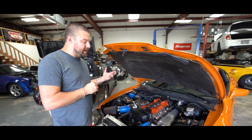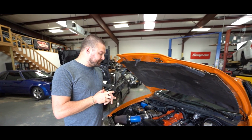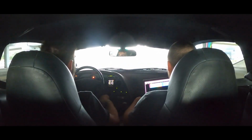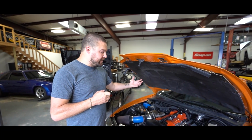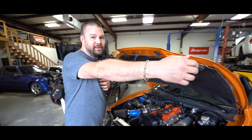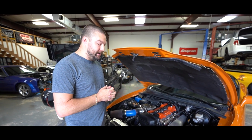Transmission controller is a lot more complex than say like a US Shift or some of these other ones out there, but at the same time it gives you a lot more tunability as far as how the torque converter comes in, when it comes in, how the gear shifts happen, the firmness, the quickness of the shifts, how much power management you want to pull out on the shift. So as you start making more and more power, you tell the transmission controller, at this power level I want it to pull 400 foot-pounds of torque on the shift. It takes that information, sends that information to the engine computer. The engine computer responds. That way everything happens like it's supposed to, and it just makes for a very reliable situation.